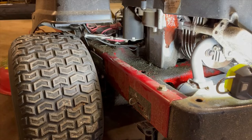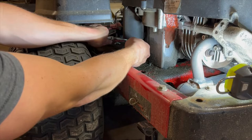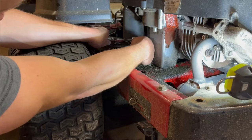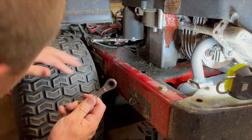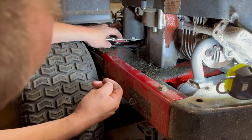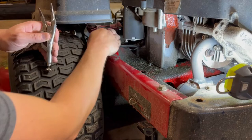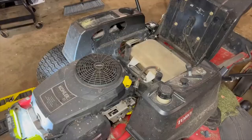There's kind of a quirk on these — the terminals for these starters have a post with a nut, and there's like another nut, and of course when you want to loosen it, it wants to loosen the whole thing. So you have to throw something on there — never fits — so we're just using a vise grip. The ground is loose on the motor there, which is good to figure out. Put that nut back on the post and retrieve the wing nut.